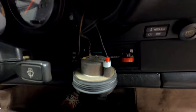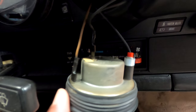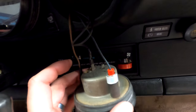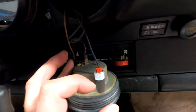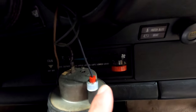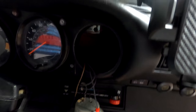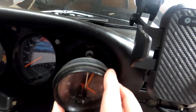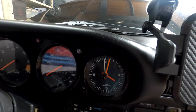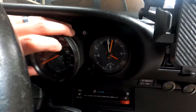A good rule of thumb: look at the colors of the wires in the back — it will help you identify their purpose. Porsche used black for power, brown for ground, and most gauge illumination wires are a black wire with a blue stripe. That's how you can identify the illumination lights on the rest of the gauges. Push the clock back in loosely — don't press it all the way in — because the wiring on the gauges is all interconnected, and having it back in place gives you a little more wire length to work with on the next gauge.